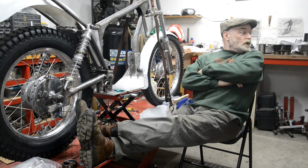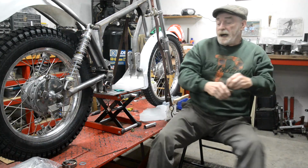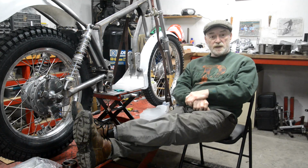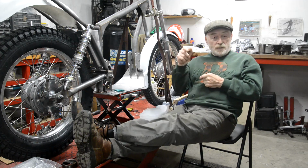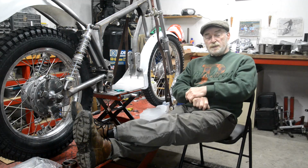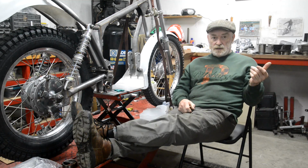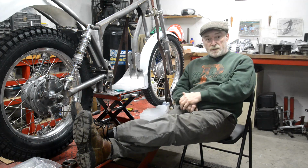We're going to do the conrods because I had a couple of comments about the gudgeon pin in the pistons. A couple of people mentioned that I could put Teflon plugs in the end to hold the gudgeon pin in, ream the pistons and then put Teflon plugs in, or ream the pistons and then redo the groove. But I got thinking about it, and it struck me that if I make the pistons match the gudgeon pins, then if ever I myself, or probably I'll be selling this, needs to replace the pistons, they're going to have pistons machined. Whereas if I do the bush in the small end eye to fit the piston as standard, then all I need to do is replace pistons because the gudgeon pin will fit.